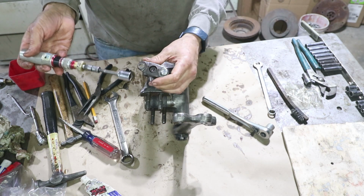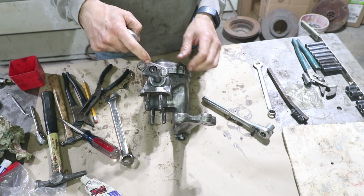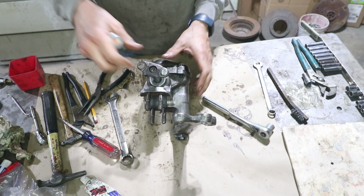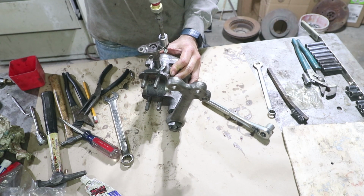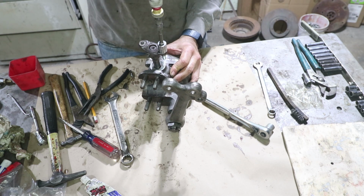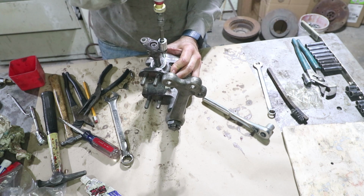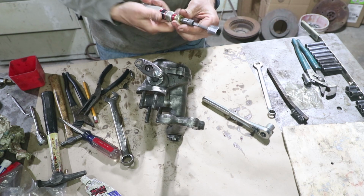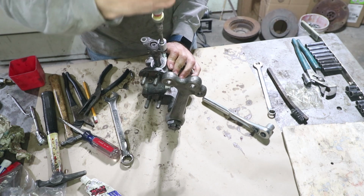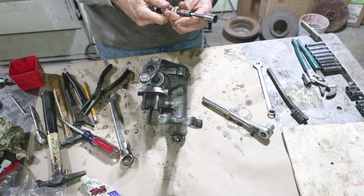Because there's no easy way to attach it here, but it's the same torque whether it's applied off the center or not. As I'm turning it here, it's actuating the steering. And then here's the center part, and that's 6 inch-pounds right there. So it is too tight. I'm going to go up to 10. Okay, so it turns at 10.